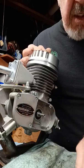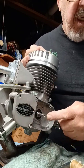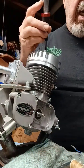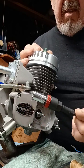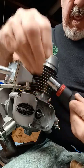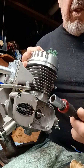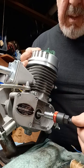Once you get that done, you get your magnet put on, your field coil put on, your nut on it. Now here's something else I want to touch on. All you guys have seen me using these tools to start these engines on the bench. A lot of you have started using them — they're all over eBay and Amazon. These little black PT tools that you can change directions on just by ratcheting the little red ring. The problem is they don't freewheel near good enough, and when you try to start that engine, 80% of the time it's going to spin the nut off.